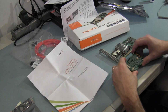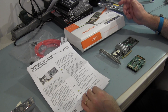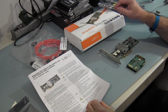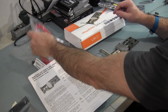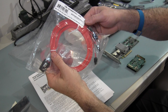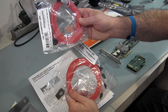Now I want to get into reading the instructions - I need to RTFM. Then I'll assemble this and show you how it goes together, and after that I'll install it into the system and fire it up. I want to see if I can get four OCZ Vertex 3 120GB drives going into RAID 0. I also have two sets of breakout cables - each one plugs into the two ports on the card and feeds four drives. I'll only be using four of them, but I have cables for both sets in case I ever want to go to eight.